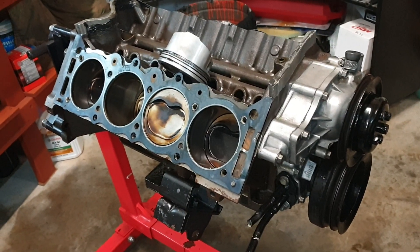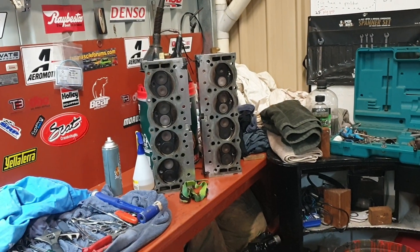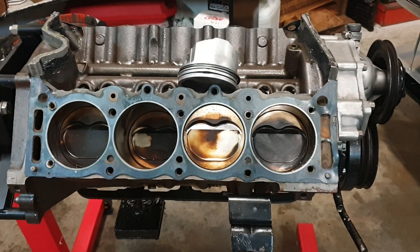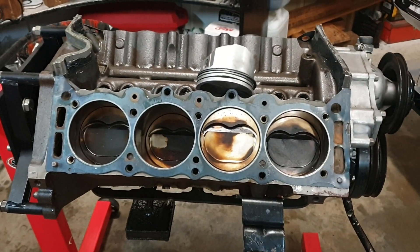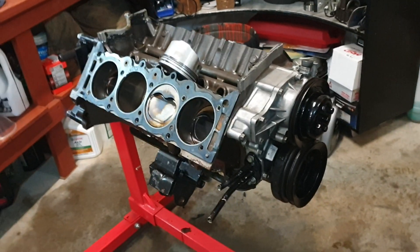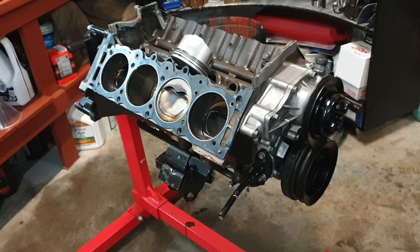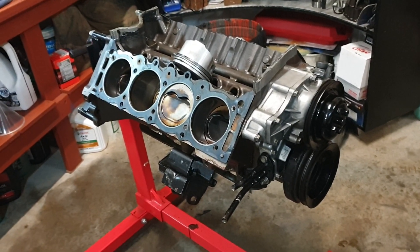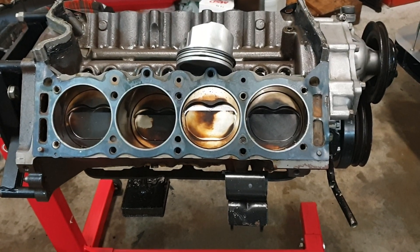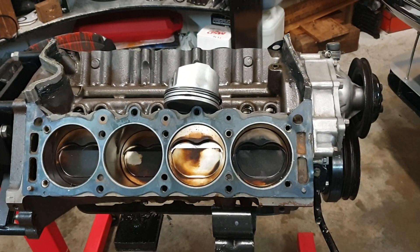Got to remember the car only weighs around 1360 kilos. Ten pounds of boost with those alloy heads — I have put down 430 at the wheels at about 4500 revs, with it leaning out and carrying on, and that's on seven pounds of boost. I haven't been back on the dyno since and don't plan on it — I'm not about chasing horsepower. I've got my mind around the tune: I run around 21 degrees total, 10 per side, with a solid low sevens to high sixes on lambda at times under wide open throttle. No popping, no banging, no carry-on, no gaskets getting pushed out. It's as happy as anything — just bloody great.